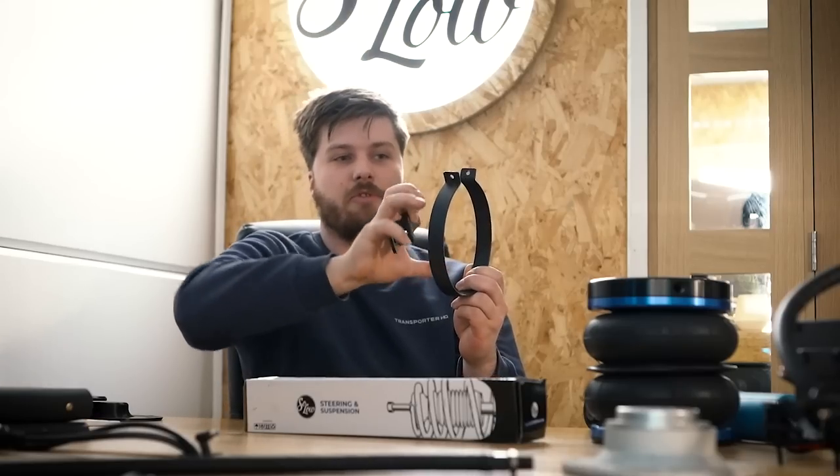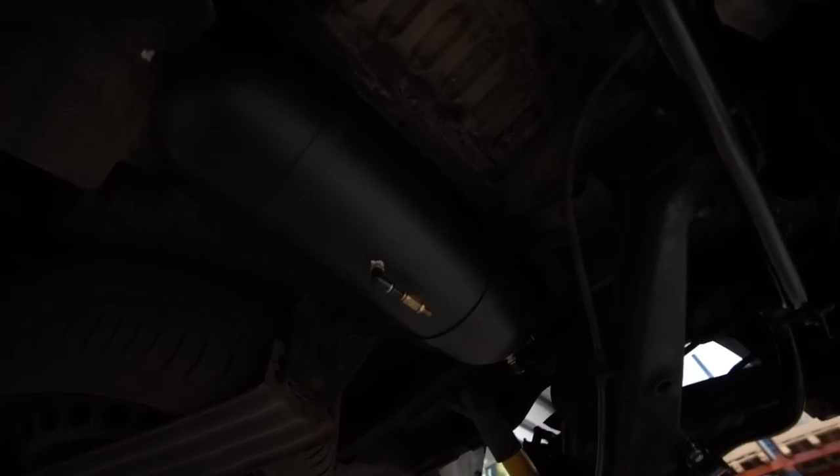Another great thing about the tank is the rotating strap mount — you can spin the tank to whatever position gets the drain port at the bottom. A lot of tanks have fixed feet, so when mounted under a van the drain port ends up at the top. When you want to drain the moisture that collects at the bottom, you can't actually get it out with fixed feet. Our rotating mount lets you always position the drain port at the lowest point so all the moisture can drain out properly.